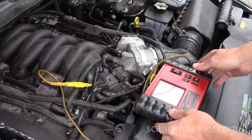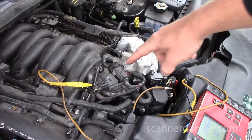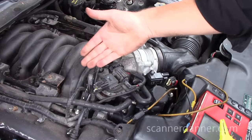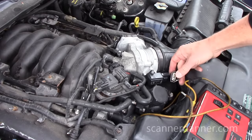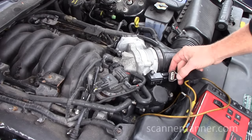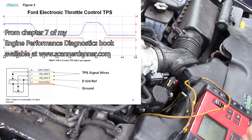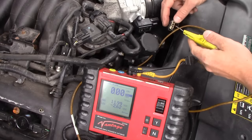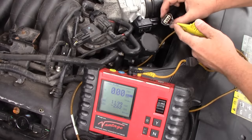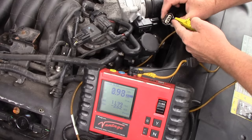Our next step: I'm not 100% sure on this fuel rail pressure sensor's reference wire, but I am confident we have low reference voltage. So I unplugged the TPS — this is a four-wire TPS that uses a 5-volt reference, two signals, and a ground. It shares the reference and ground. One of these four wires should absolutely have 5 volts on it. I'm going to go down the line. I'm front-probing this connector but just touching the terminal itself.